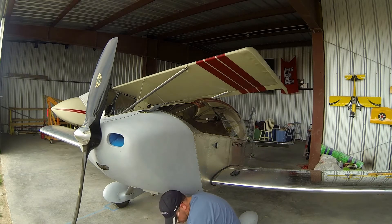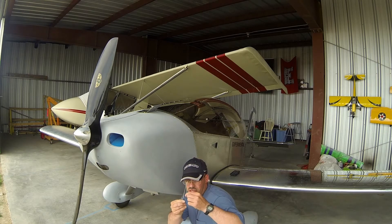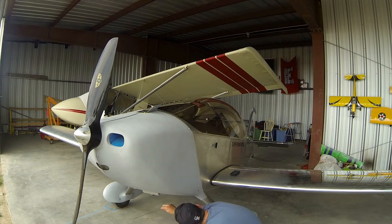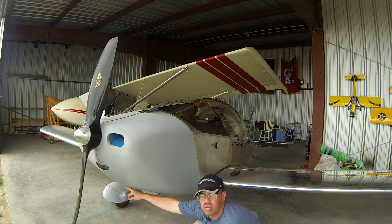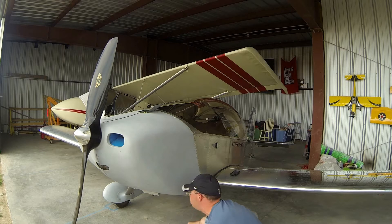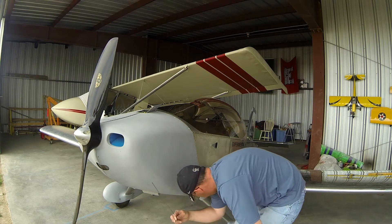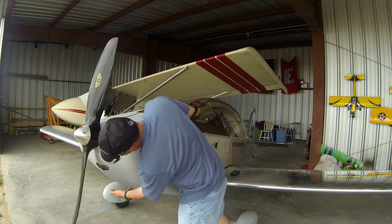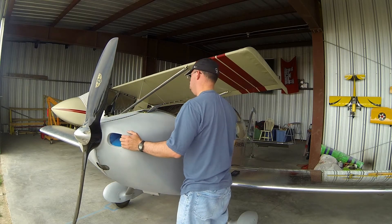On the bottom I've got short hinge sections and I can just bend them and pull them out — that works really well. I've also got one long pin that only goes to about right here. The plans have you go all the way to the top, but what I found is that trying to make that bend is hard on the hinges, hard on the pan, and it just doesn't work very well. So I don't do it — I use an extra SouthCo down there instead and that works just fine.